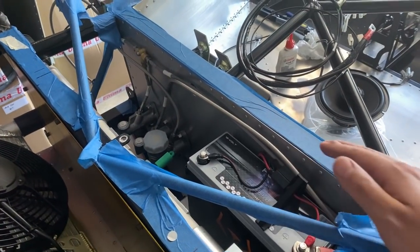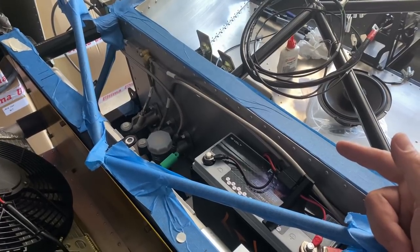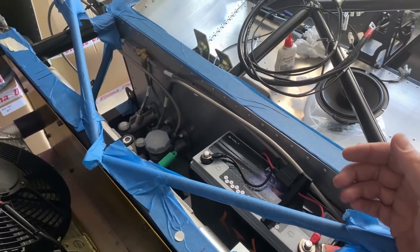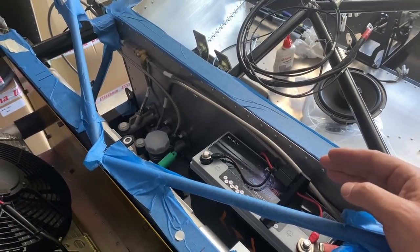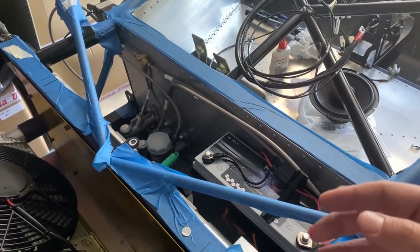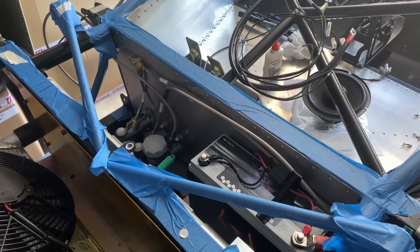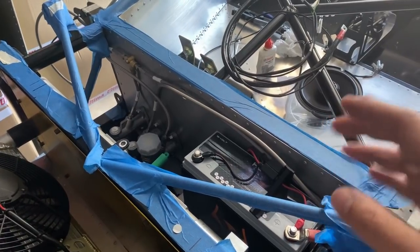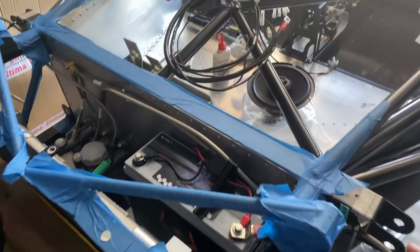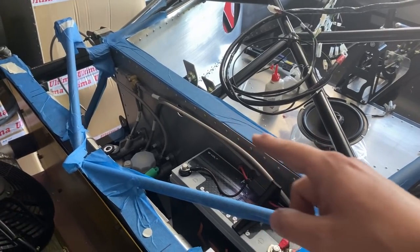Anyhow, obviously solid lines are ideal for a number of reasons. They don't flex at all, but they're infinitely more expensive to install. They need to be bent properly using a brake line bender, and they need to be fitted off very carefully to make sure that you're using the right flaring tools. There's a whole number of different flares that you need to use depending on what style of braking setup and fittings you're using. That's probably a much larger topic that I probably won't cover on this car. The car that I'm building after this actually does have solid lines, so I'll cover it on that at a later date.